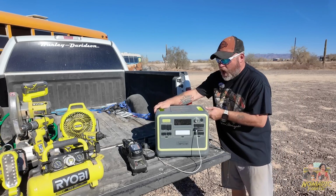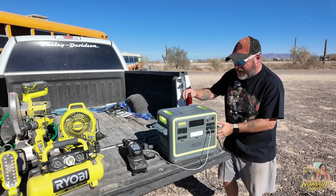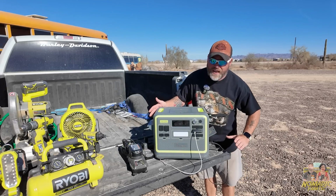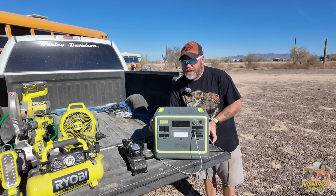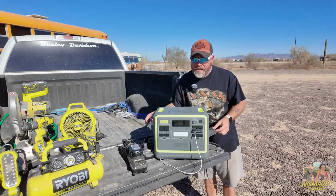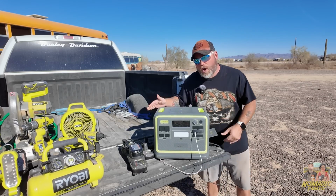But moving along, this one is also unique in that these flaps right here, this is your left fan cover. This is your right fan cover over here, and you have to open these every time you are using this power station. Even when it's just being charged, you have to open these so that air can be sucked in on the side and then gone through a fan and blown out hot air on the side. With these closed, if you forget to open them, you will get a warning indicator. This will stop charging. It'll also stop working. It'll shut down if it gets too hot if you forget to open these. Now, I like that they don't need to be open for storage. These two, they don't need to be open all the time. They can be closed, but they do need to be open to be operated.